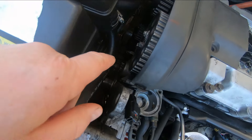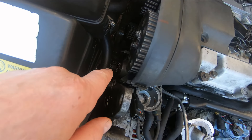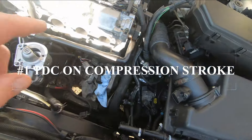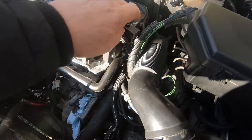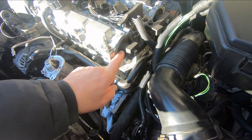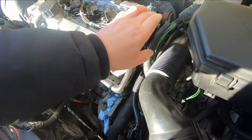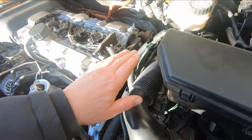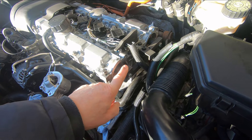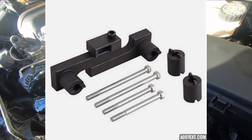When that's in and you turn your crankshaft, it lines up on the pulley at the point where it's supposed to be for top dead center. Then you take the covers off the back and put this locking tool in — there's a slot in the end of these camshafts. On the intake one it's a little higher and on the exhaust one it's a little lower, so you can't mix them up. The tool only fits one way, and it locks them together so they can't turn.